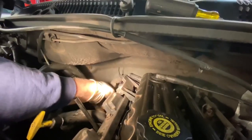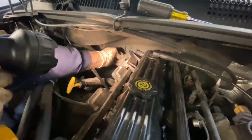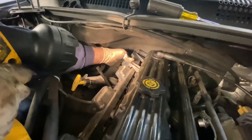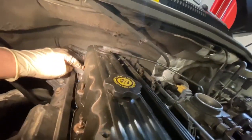And we have this one down over here as well that we've lined up. If you try and put this on after, it's pretty much impossible. You've got to put the tie wraps in place before you do this. And once it's tightened down and we tie wrap this on, it's got a nice clean distance away from the back of the valve cover. Nothing's gonna rub. And let's just find a washer for this one right now.